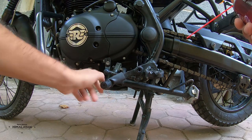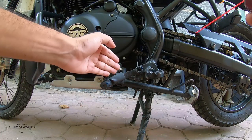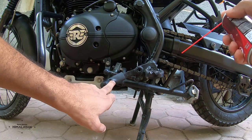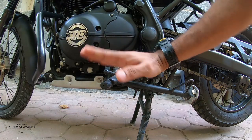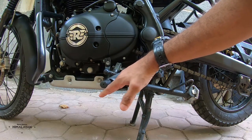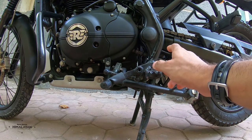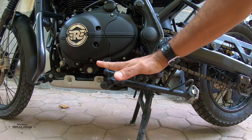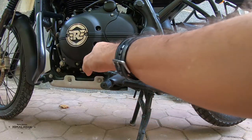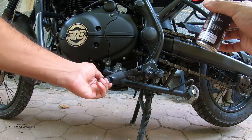This particular gear lever comes straight from the factory. The advantage of having it straight is that when you go off-road it's easier to shift up and down. But in this lowered position you'll find it a bit difficult to shift upwards — you have to get your boot down and lift up, which becomes tricky with adventure boots and gear. Pivoting foot pegs definitely help. But the idea of lowering the gear lever's position is to have more leverage when you lift up, generating a lot more force.